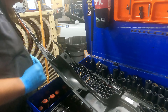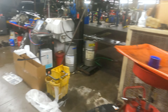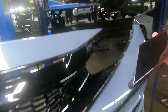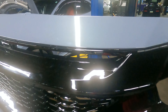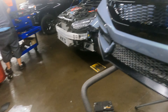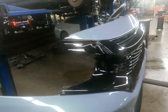How would you have known that? You just have to know — when you do enough of these, you learn things. There's no directions or nothing with this grille, so you have to transfer the stock clips. That clip goes in this space right there and then transfers over. Oh, that's a screw — that sucks. It would be nice if they included some directions. Brent's getting the final clip on for the other side.